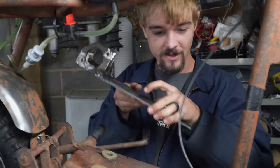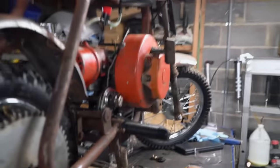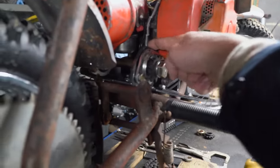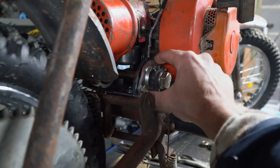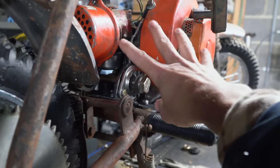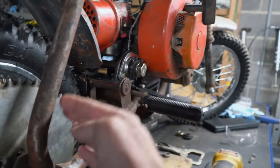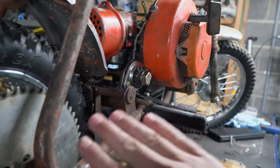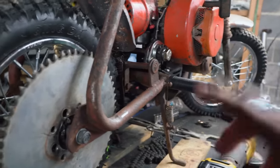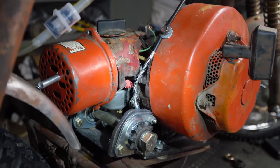Is going to be fun. Remember this? Oh, I remember this. Unfortunately, we made a boo-boo. We did not give ourselves enough room for the throttle linkage right here because the bearing originally was on the backside. You couldn't hit the throttle. It was jammed up. We moved it to this side. We no longer have sprocket alignment. We were too focused on getting those two sprockets to line up. We were not paying attention to the throttle linkage